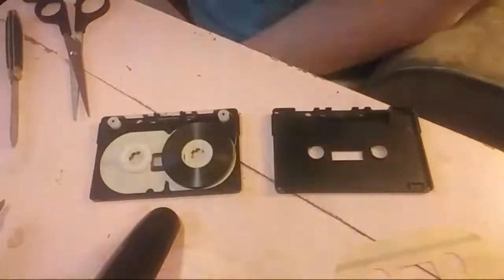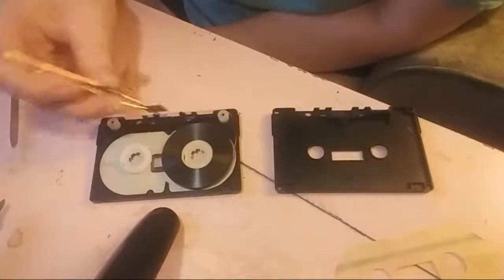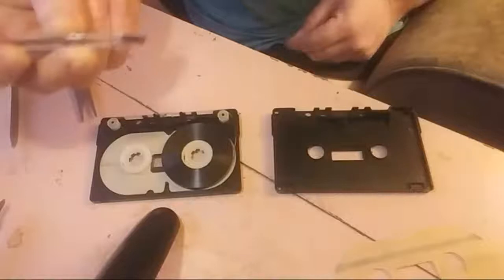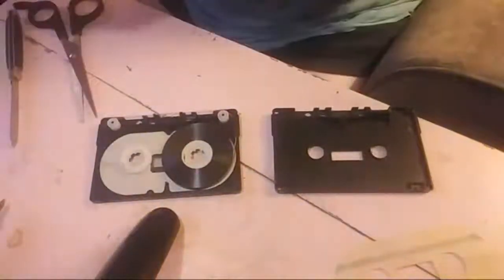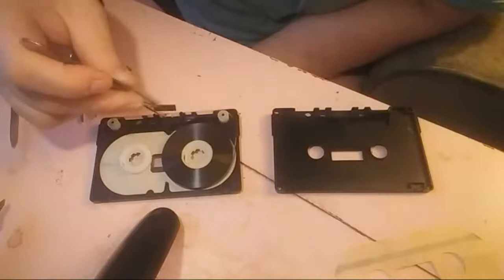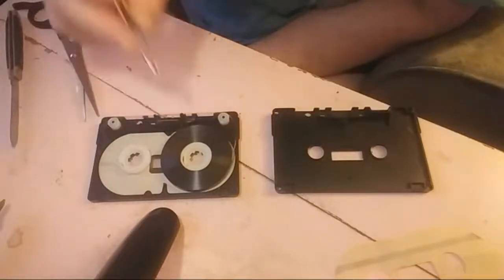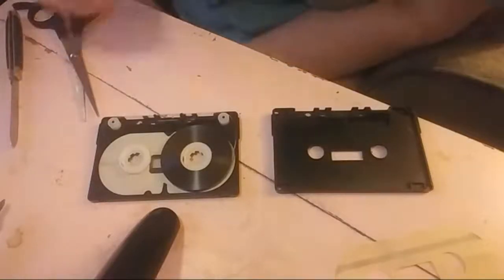The parts of the tape — I've gone over the slip sheet. This metal piece right here comes out. You know what this is? It's a magnetic barrier. It's a piece of metal, and the purpose of this piece of metal is that the heads in the tape player are a magnet — they function as an electromagnet. It stops the magnetic pulse from the recorder from going into the tape pack.